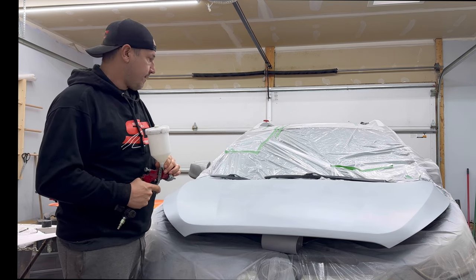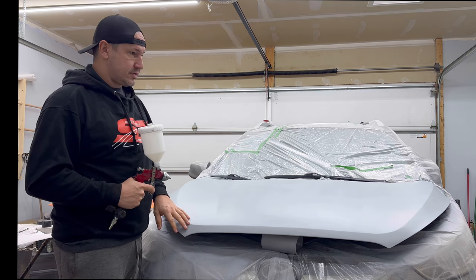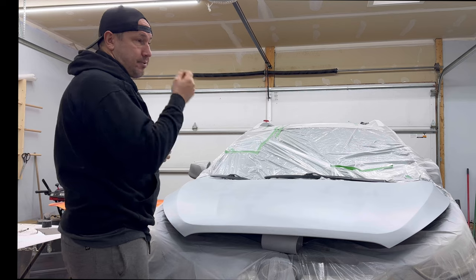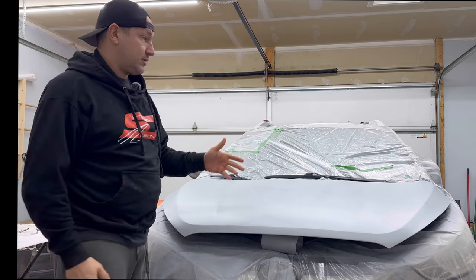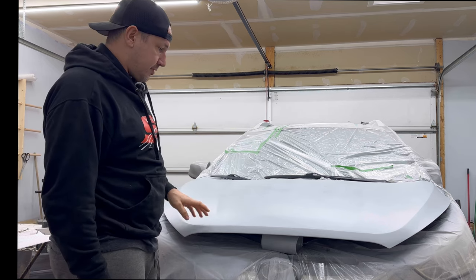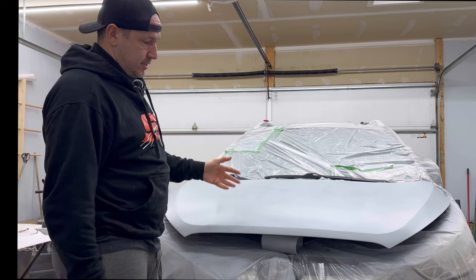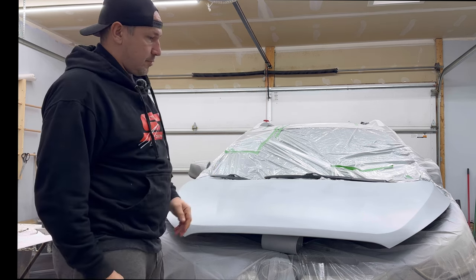So anyway, I've got the paint and everything. It looks pretty good. We're gonna end up spraying it and then we'll let it sit overnight. Again, I don't have a paint booth, obviously. In my shop in Martinsville, I painted my entire Hummer, primer and paint. The priming doesn't have a lot of overspray. The paint and clear has a pile of overspray. So with that said, we'll sand this, peel the plastic off, push it outside, blow it off really good, then tack cloth it.